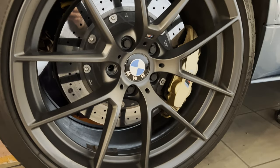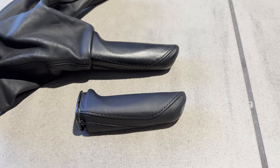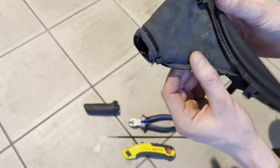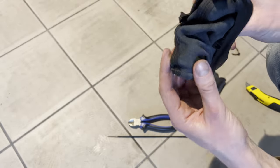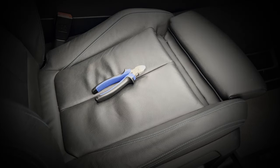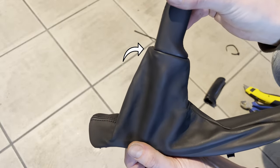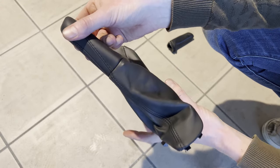Once the handbrake is adjusted, I thought it would be fitting to renew the handbrake lever as the one in the car was a bit shiny and worn. Interestingly enough, the handbrake cover is attached to the handbrake lever with a tie wrap — apparently BMW assembles these like this. So with a Stanley knife we carefully remove the tie wrap, then insert the new handbrake lever, wrap a tie wrap around it, and cut it with these pliers. Off camera I went ahead and redid the tie wrap, this time in the correct orientation. Now let's put this back in the car.